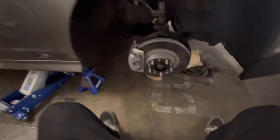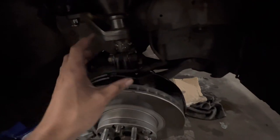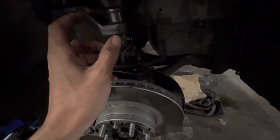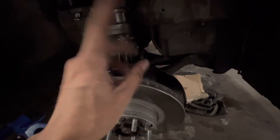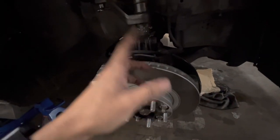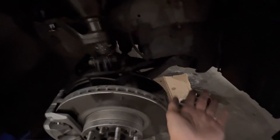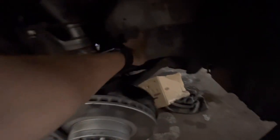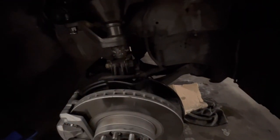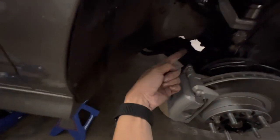By the way guys, if you follow me on IG you know that I have a massive oil leak — you can see the oil right there. There's a huge leak on this side of the engine. It's either the tensioner plate, the VTC sensor, or possibly the oil pressure switch. After this project, look out for videos on me taking off this splash shield. I'm probably just going to disconnect it and fold it down, then reseal this side of the engine, pressure wash it all out nice and clean.